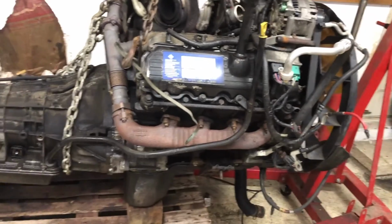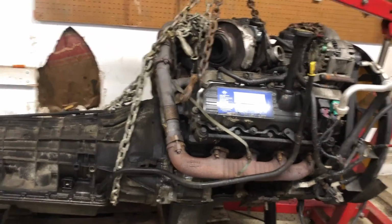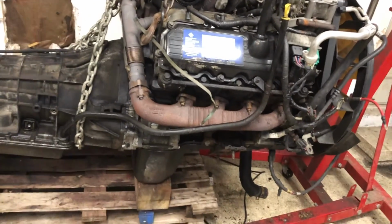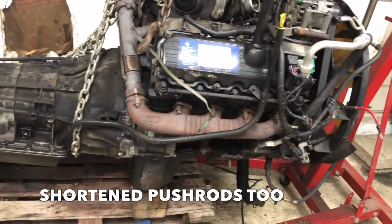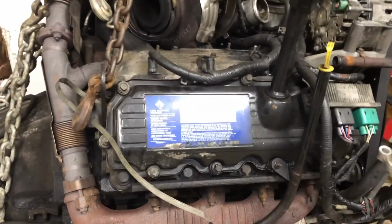I'm gonna get that body up, and then I'll be back in the same situation I'm in now, and that will be after that Bronco's already been proven running and driving. Then I'm gonna go back and do new head gaskets, new O-ringed heads, and then ARP studs, which I would already have at that point, and then put it on. Seal the head gaskets and not have to deal with that anymore.